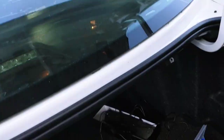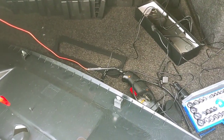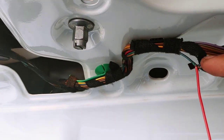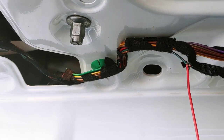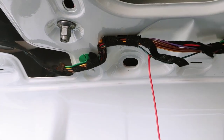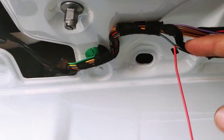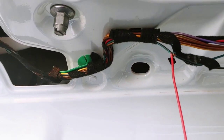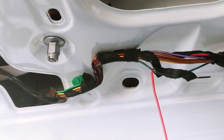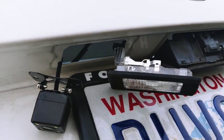Once that's done we'll connect everything. I've figured out and tested that this is my backup wire — for me it's the green and black. Different models have different setups; a couple of videos I've seen confirm this is your backup wire. I'm going to solder that last, after I run all the wires and have everything set up for the camera.